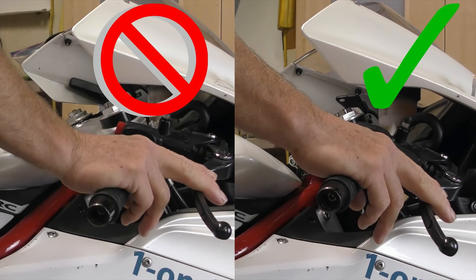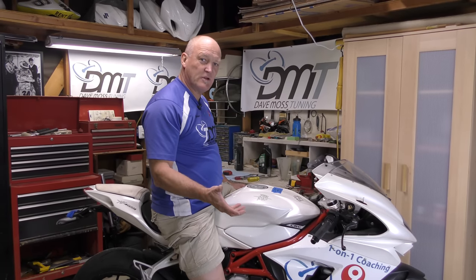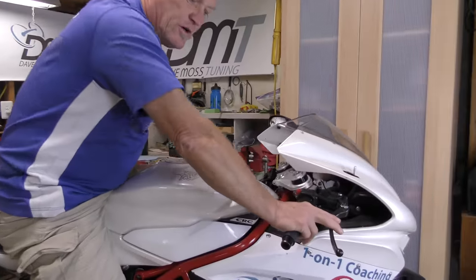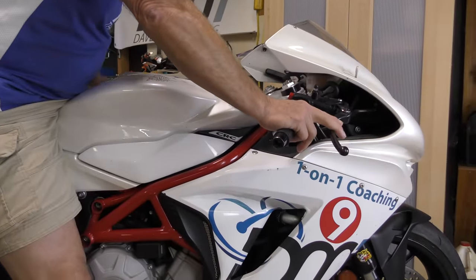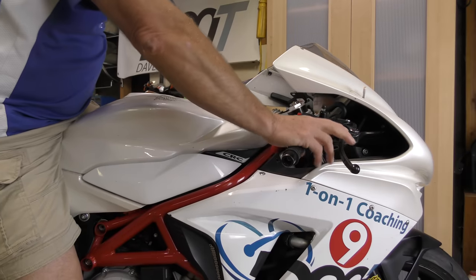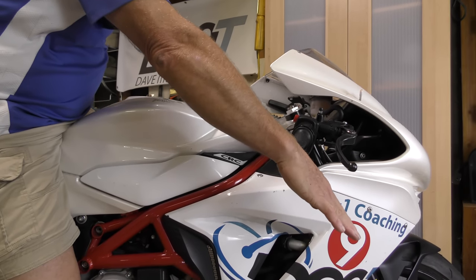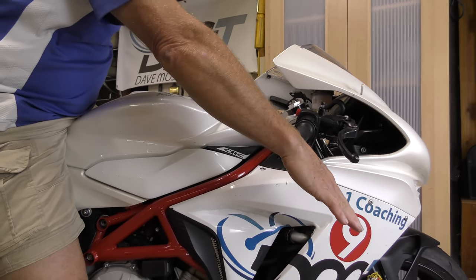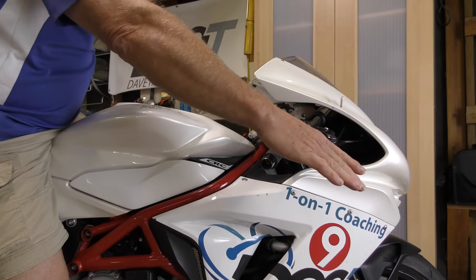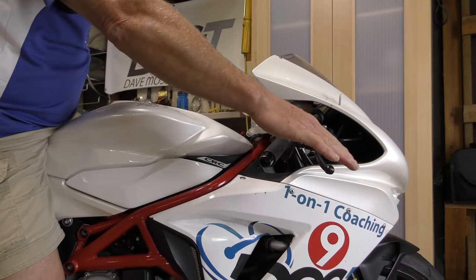Setting your brake lever correctly — the quickest, easiest way to do it is quite simple. First, do you have an angle in your wrist? I obviously have a very acute angle in my wrist because it's not straight. So no matter what the angle is or what type of bar you have, you always want to have something that's relatively straight.